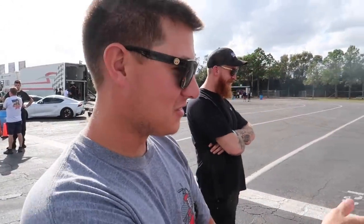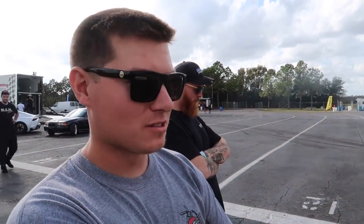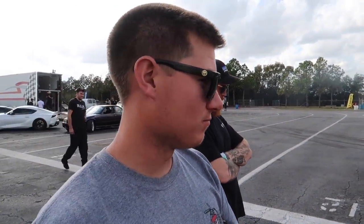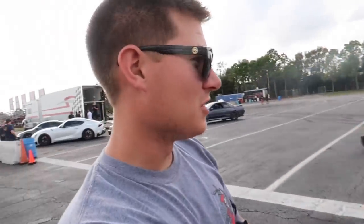It's pretty simple. It's a junkyard 5.3 motor with Texas Speed rods and pistons and a stock crank, and it makes about 1,000 to 1,100 horsepower depending on the tune-up we have in it. It's a Powerglide with a 9-inch, so it's a super common setup in drag racing. They just work. The LS with a turbo like this just works.